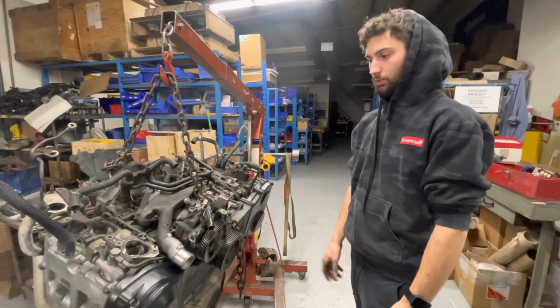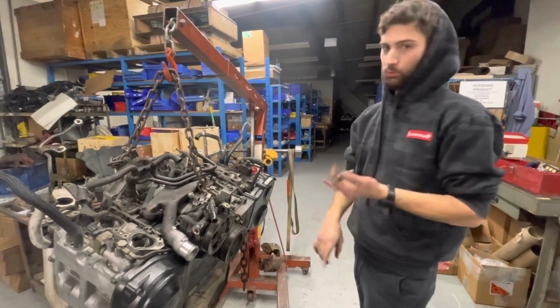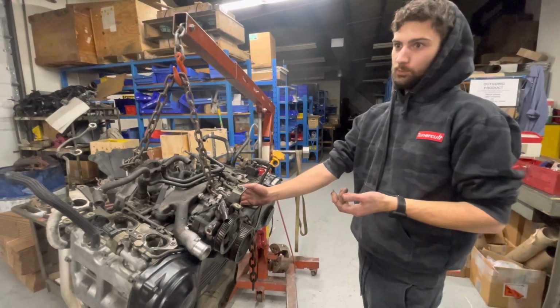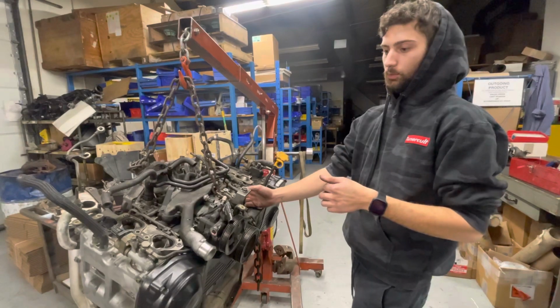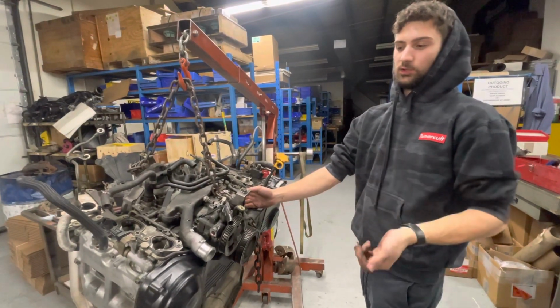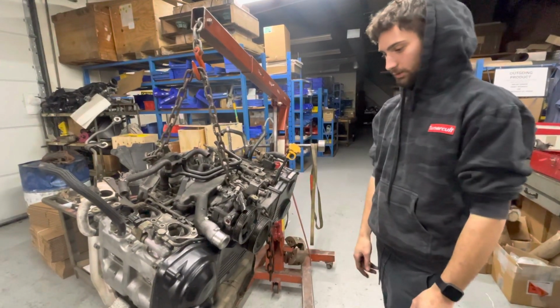All you really need to do when you plop this one in and swap your intake manifold on is get a tune for the 2.0 versus the 2.5. These are higher compression. I think it's like an 8 or a 9-to-1 compression ratio versus the 8.5-to-1, which is in the EJ255s. That's pretty much that. We'll go ahead and unbolt the header now.